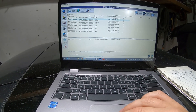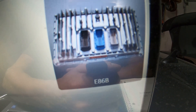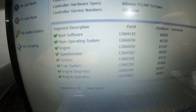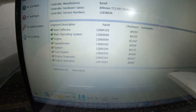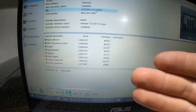There are a few different things in the code or operating system for the van compared to the truck — pretty minor stuff — but it might actually be better suited for this car. Using EFI Live, I already have a van OS ready to go. The van operating system I'm going to use is 12660050. It has to be for an E86B, not an E86A. These different segments inside the OS are almost like subsystems — you are able to swap them out in a segment swap, and possibly find the right one — might be the speedo segment or the system segment. But first we're going to take this van file and do a full flash.